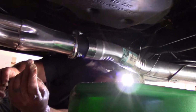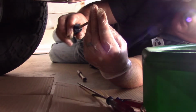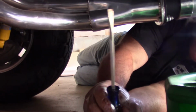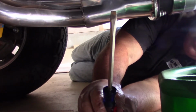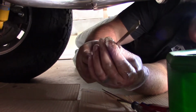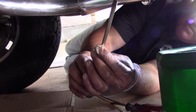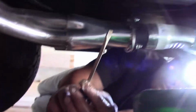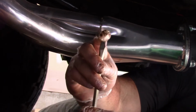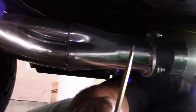All right, don't get a screwdriver that's gonna gouge that aluminum housing. Get like a wider blade, more of a dull one. So this is a modified screwdriver. I actually broke the tip off, but I took it to the bench grinder. I broke it a long time ago, but anyway, I use this blunt screwdriver just as a prying tool. That's less likely to gouge that aluminum surface because it's pretty dull, and it's got more of a wedge to it with that blunt end.